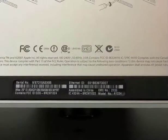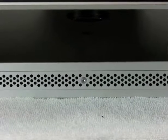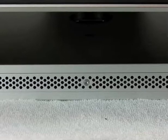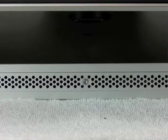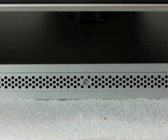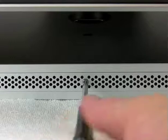I'm going to lift up the foot here — it's hinged — and tilt the camera down a little bit so you can see the cover. Right here is the cover. There's one Phillips screw in the center, and Apple has chosen to use a larger Phillips screw than they do on the majority of their computers, so most homeowners would have a screwdriver that would fit, like a drywall screw. That's actually the size of the slot — that would be a Phillips P2 or a P1. I'm going to take my screwdriver and remove the plate to expose the memory slots.